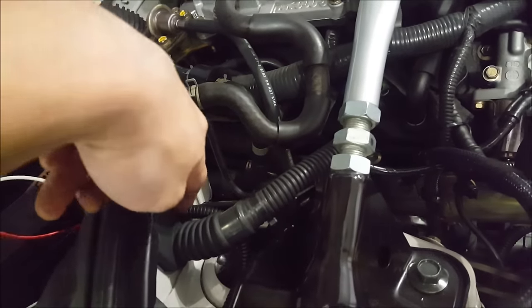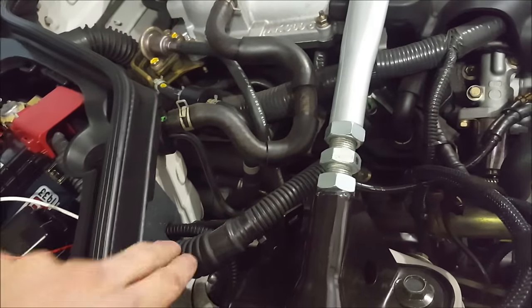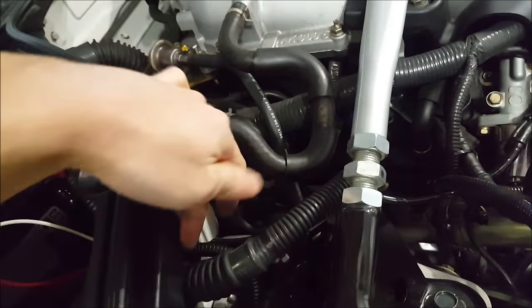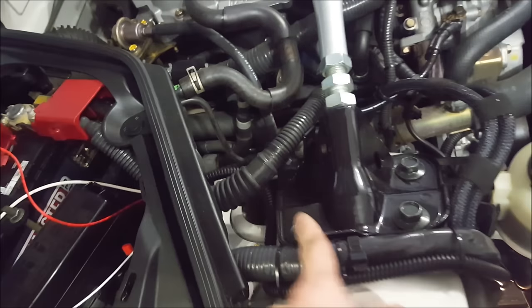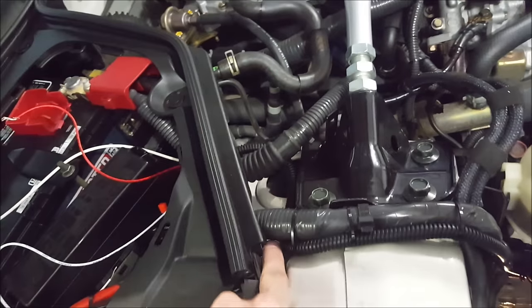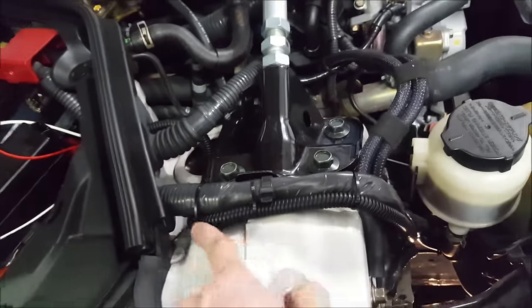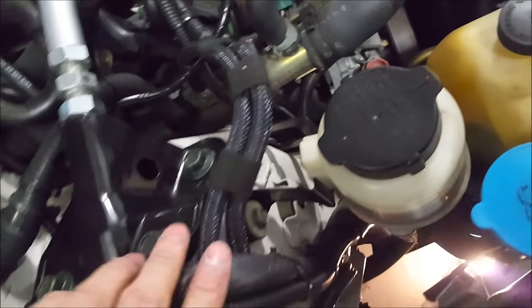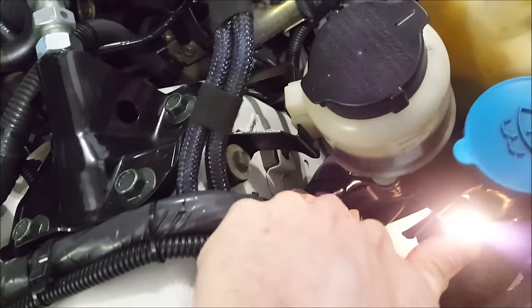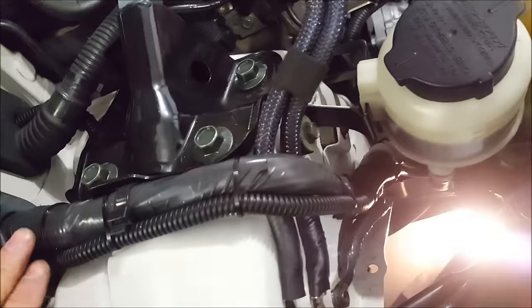I already made a slit in the loom before from my grounding kit install. There's enough room for me to run the loom and pass it through — that's going to hold everything together so the wire never wants to come out and it's going to look nice. I ran underneath each harness; you can just pull this up a bit from the grommet to make room. I zap-strapped all the way along, running with all the factory lines. The additional ground wires are out of the way because the factory harnessing is engineered to work like that on the car, and it's going to look clean.